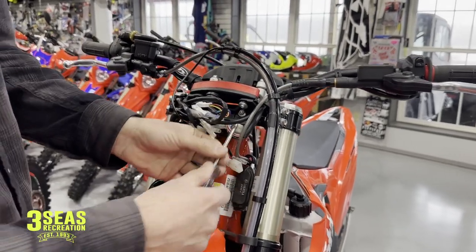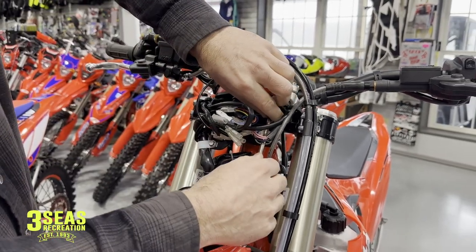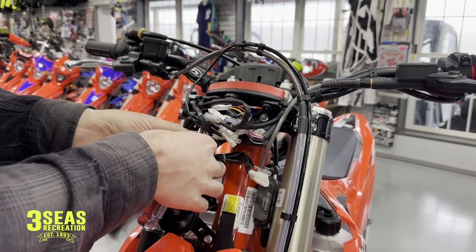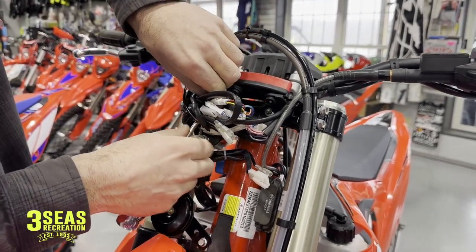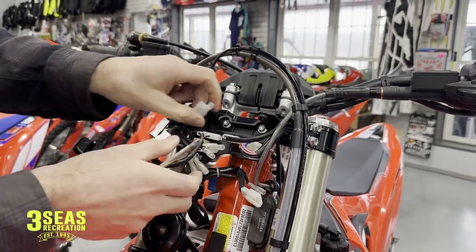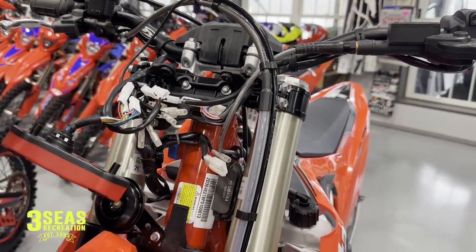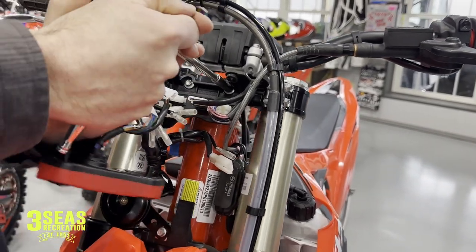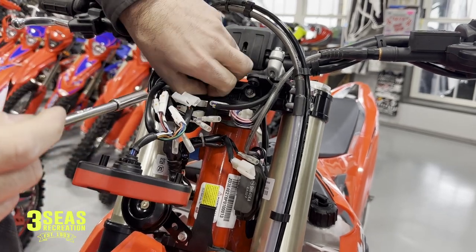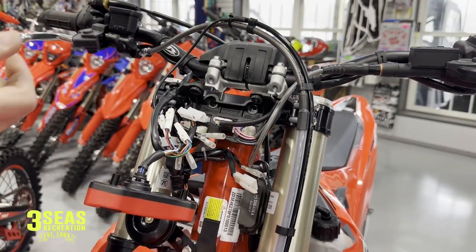With the headlight mask out of the way, we're going to remove our display first while it's still screwed to the bike — it's easier to hold and avoids hurting the screws. Come up through here, find a good spot, and try to get straight onto these little Phillips head screws so you don't hurt them. Don't torque these down too much — I've seen a lot of folks online break the little tabs off the back of these displays; they're kind of fragile. We're going to take these two screws off, pick the display up out of its bracket, and rotate it out of the way. Now we're going to do our Phillips screws in the middle — we've got two of them. We'll use our 8mm and crack them loose. Hold onto these screws because they're going right back in pretty much the same spot in a minute.